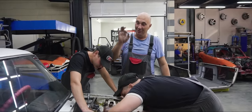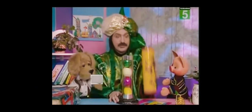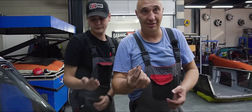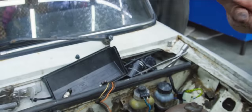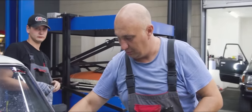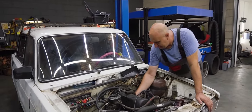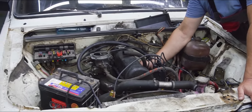I've got so many thoughts racing through my brain. You would have seen us load seven tiny balls into cylinder number 2. How did this get into cylinder 4? And judging by the color, it's been there for a while. It's all a big mystery — how did this tiny ball even make it into cylinder 4 from 2? Even if just one ball is left in there, the piston will lodge into it at top dead center, with the ball pushing into the cylinder head, and the piston might crack. We saw that the engine wasn't rotating. Now we put the spark plug back in on cylinder number 4.